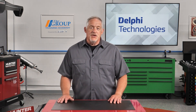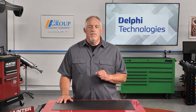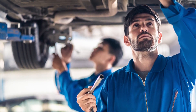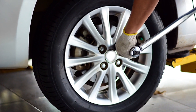Even if you don't plan to install a new tie rod or ball joint, always check service information to determine if a TTY ball joint or tie rod end is reusable after removal. Once a new part is installed, perform a final visual check of the other steering and suspension components before reinstalling the wheel.